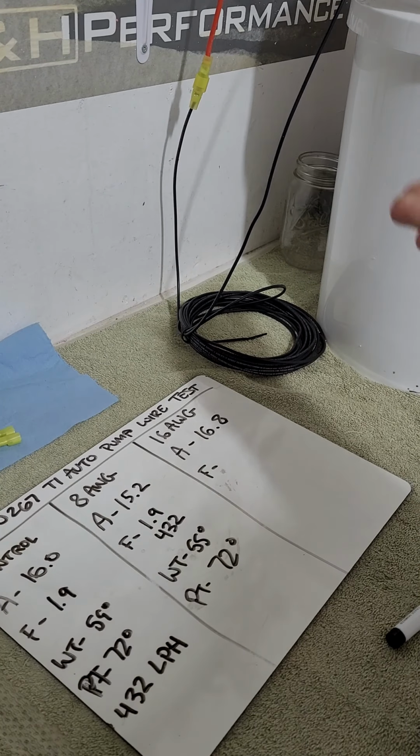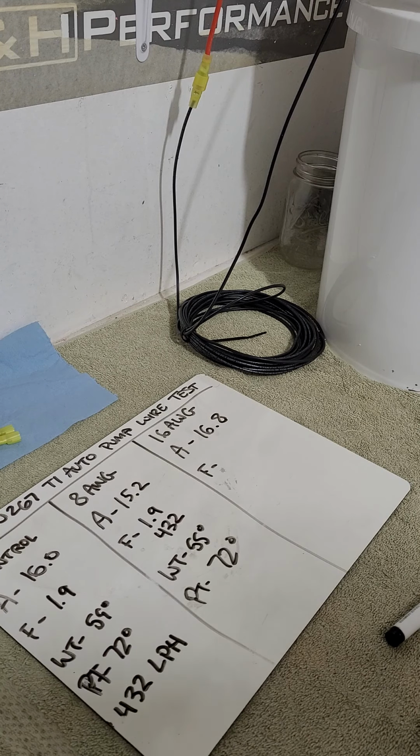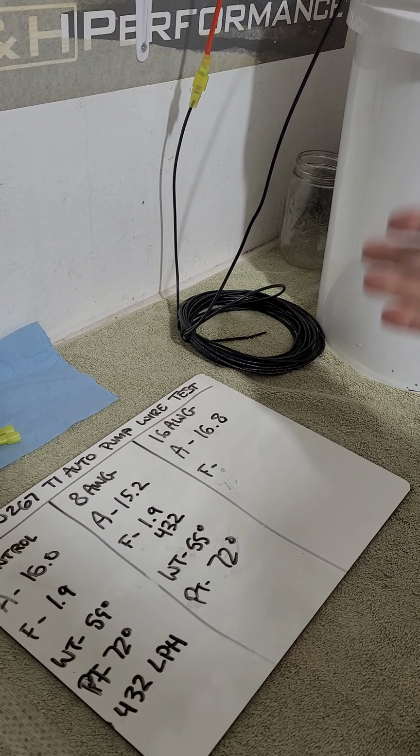Right, and with metal, when the temperature of the copper wire in there increases, the resistance also increases. So not only is there more resistance in the thinner gauge, longer wiring initially as it's overworked, but as the temperature of the copper wiring increases, resistance increases as well. So the longer you run with inadequate wiring, the hotter your pump's going to get. The wire's going to overheat. It could melt fuse holders, receptacles, right? It could start a fire.